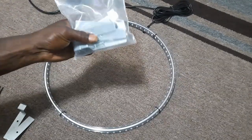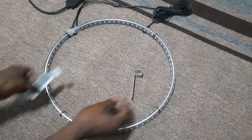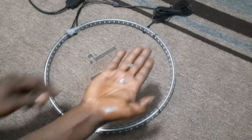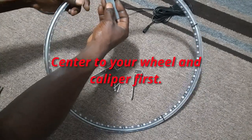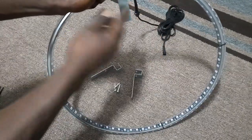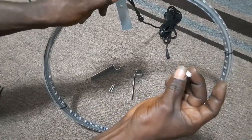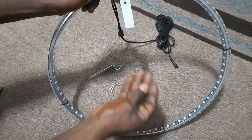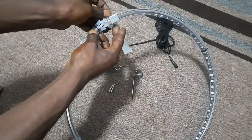When you open your box, you're going to have a couple of these brackets that are going to wind up going with each ring — I'm going to have a few extra ones. So I got my three brackets out right there, I'm going to use three of these screws and three nuts. You want to make sure you have this positioned so that when you put it in, your ring is going to be on the outside and this will be on the inside — therefore your shield will sit more in and push your lights out more. Grab this screw, drop it in through the top, take your nut, and go ahead and screw it down.